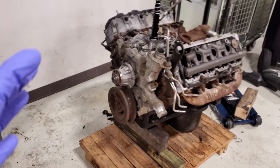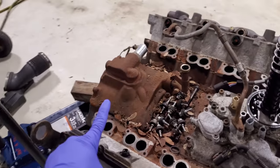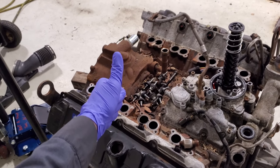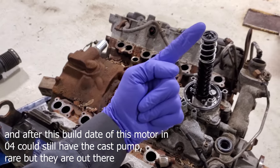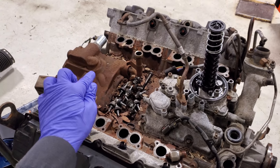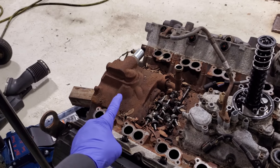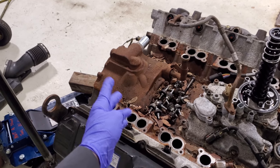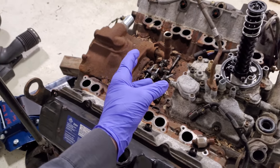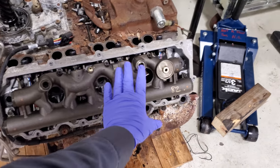What we have here tonight is an early '04 6-liter. We have two different styles of high pressure oil pumps in 6-liters: the Spicer cast iron pump, which is in '05 all the way up to '10 in the Econoline, and the Rexroth aluminum high pressure oil pump that is in the early '03 6-liters. As production went on through the '03 model year into '04, some of those characteristics were carried over, but still featured '05-style under-the-valve-cover oil manifolds and stand pipes.